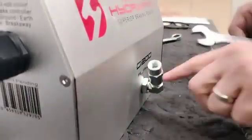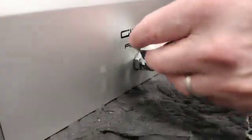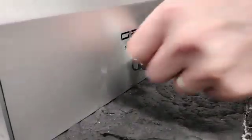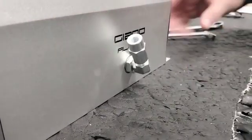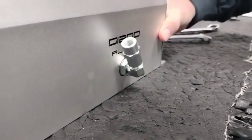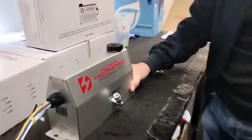The other thing you need to make sure is the end fitting here that the brake line fits to needs to be tight, otherwise it'll leak. That's an inverted flare, I believe. So you can tighten that up until it's fairly firm so it doesn't leak. If it does leak from this point, you just need to do that up a bit tighter. So that's basically how this fitting will go on correctly without any leaks. Thanks.